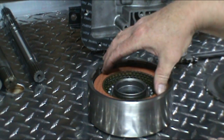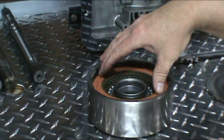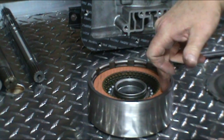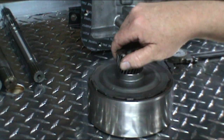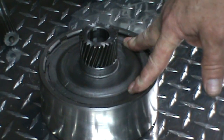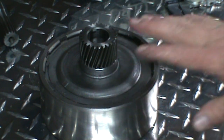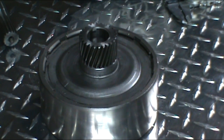Now if you don't have the proper clearance, you're either going to have to try to add another steel to the bottom to take up play. Or if you're too tight, you might have to machine that piston a little bit to get the proper clearance. This is a stock V8 application piston — not a V6, so it's a little thinner — and we'll have exactly 100 thou play when we put the reaction plate and snap ring in. Acceptable clearance for the clutch pack: anywhere from 60 to 100 thou is fine. You don't want to get outside those tolerances. If you go below 60, it's too tight and the clutches may drag. Anything over 100 thou is just too much time for the clutch pack to apply. So you want to be between 60 and 100 thou.